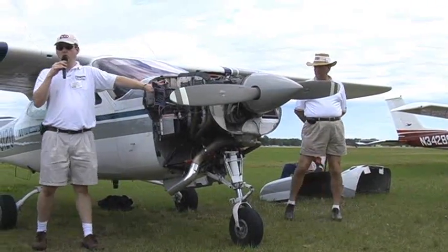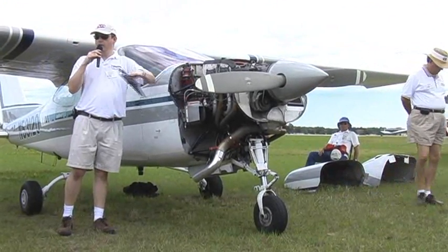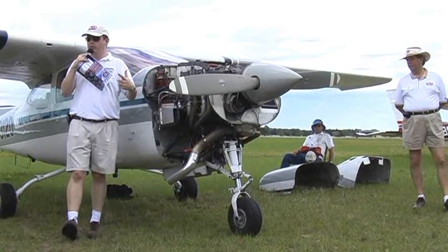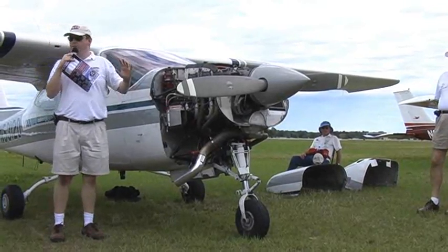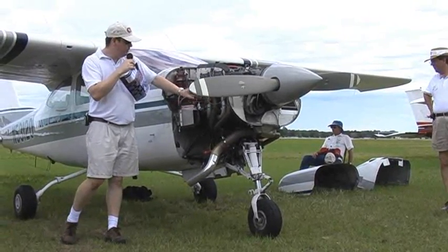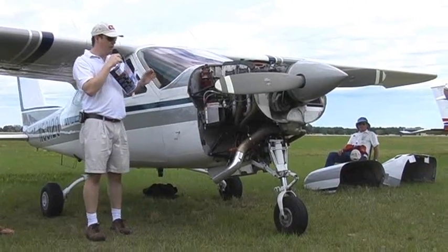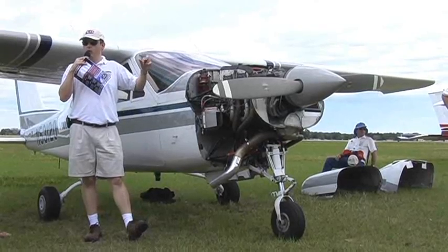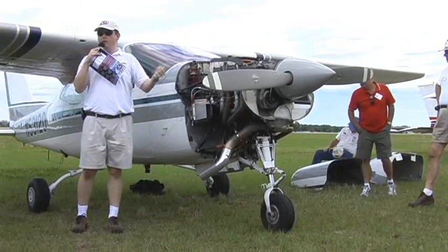The Cardinal RG is a 200-horsepower engine, but the installed horsepower is not 200. When Lycoming rates it, they use a neutral stack — something that neither helps nor hurts the exhaust — not what Cessna actually puts on it. This exhaust system is designed to overcome a lot of the inadequacies of the original. It is possible with tuning to get up to seven percent more horsepower than with a neutral stack, but we optimize so we're not producing more than 200 horsepower at sea level.